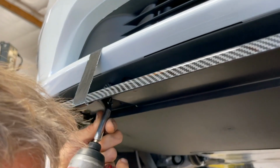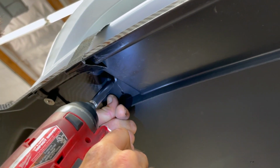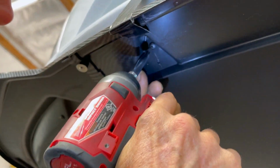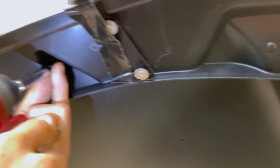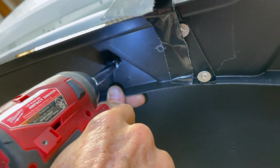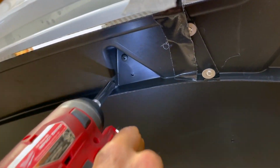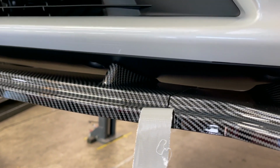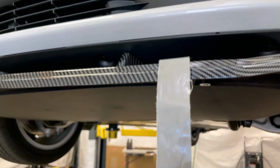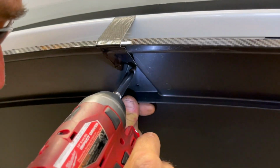Use a nice handheld drill. Do it gently and slowly. You can do it by hand. They really bite through the ABS plastic underneath the car, and these self-tapping screws are perfect. You can use a hand drill like this. Just stop once it gets all the way in. You shouldn't have to ever loosen or tighten them in the future because they are self-tappers. So again, let's hit all of these locations. There's a total of 14